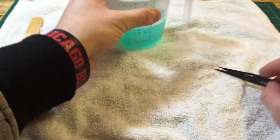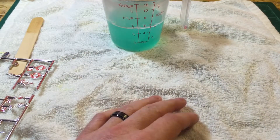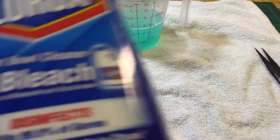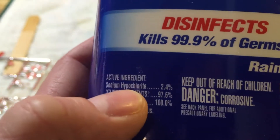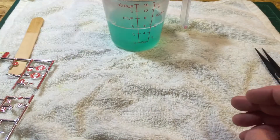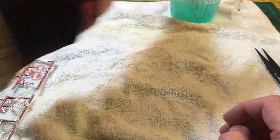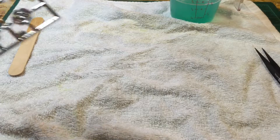Within maybe about a minute and a half I've had it in on the video. Some people are a little leery on using bleach, but basically any bleach with sodium hypochlorite as the main ingredient is what's stripping the chrome. You can mix your own ratio — as long as you put a little bit of water in there you shouldn't have any problems with ruining the plastic.